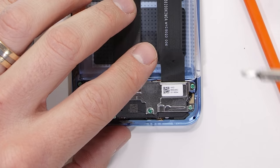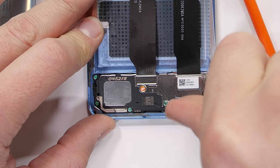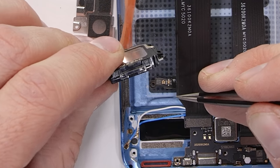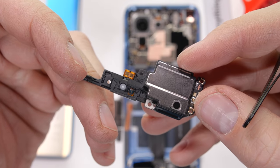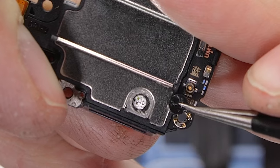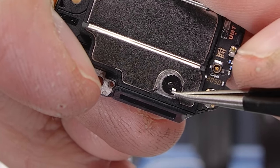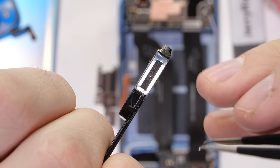The bottom speaker is held in place with seven screws — still the same little green guys. I'll link the tool kit I'm using in the video description. With the wires unplugged from the speaker, it comes free from the phone and we can check it for balls. Indeed, underneath the little sticker are thousands of foam sound dampening balls. These help the speaker sound bigger than it actually is — the balls give the speaker more surface area inside for the sound to resonate off of. There's also waterproofing on the speaker unit itself.